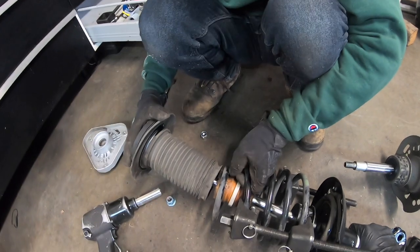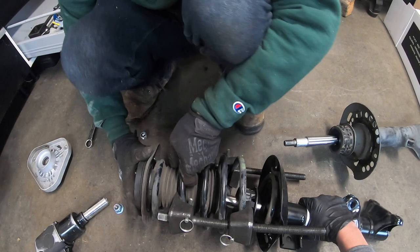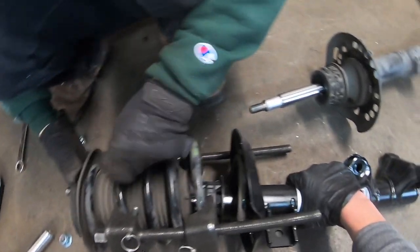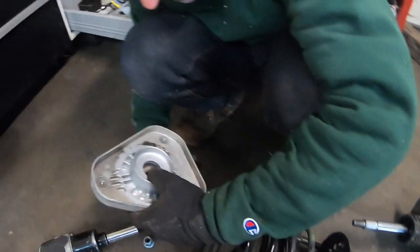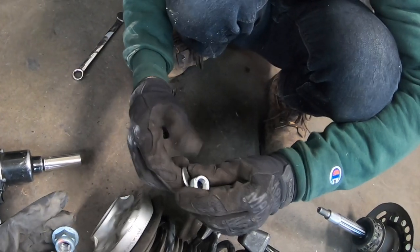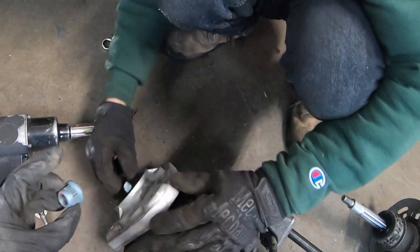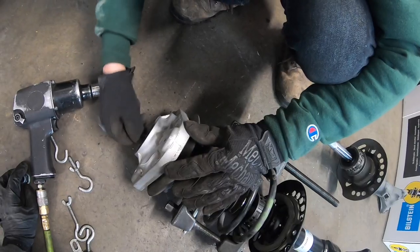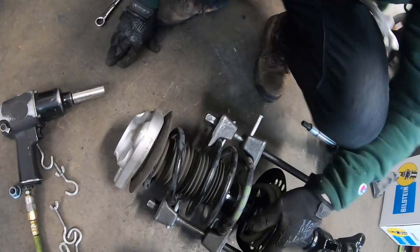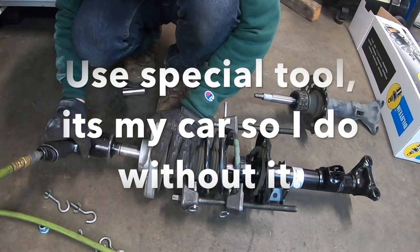You can see that the spring will be difficult, right? Very nice — then line them up. I previously marked it with a line to know how to align it, just in case it matters. I'm not sure if it does. Here I see that it has to be torqued a little bit. Make sure that you align the bottom of that spring with the tab that's on the shock absorber.